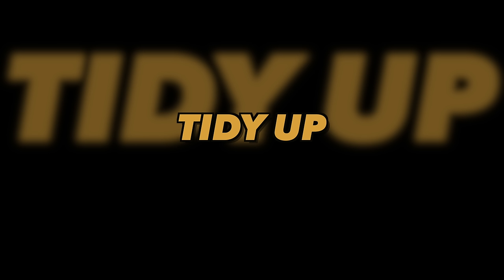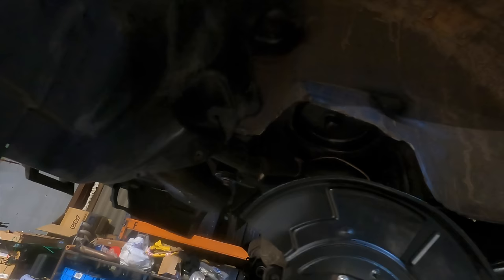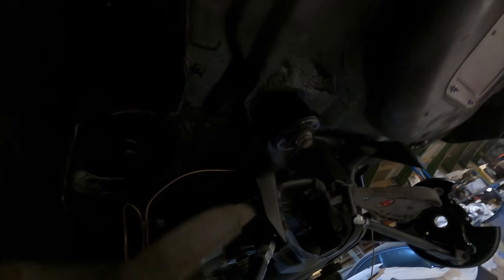So the rear end is mostly together now. I didn't video it, but I've installed the trailing arms, the camber arms, and the spring perch. So remember, everything's spherical. It's Bimmerworld bushes on the trailing arm, and then it's PMC on the rear arms between the subframe and the trailing arm. Articulation, very nice. But you might have noticed the barn, quite messy.